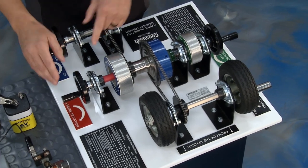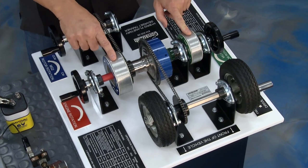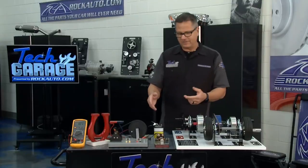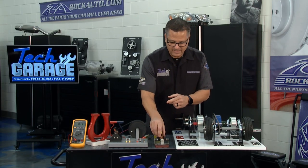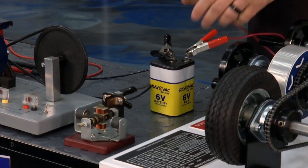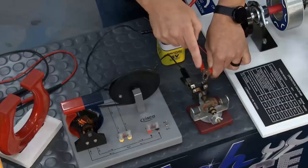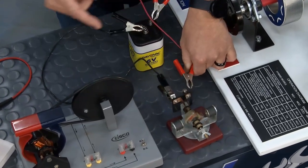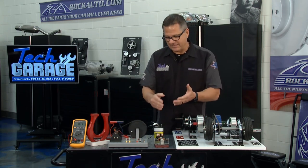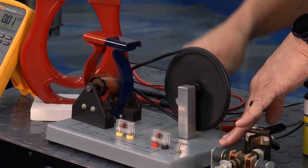It all boils down to how the car works. You have a motor here — we call this an ICE, internal combustion engine — and then you have one or two motor generators. We have to know what's a motor and what's a generator. I have a simple motor with a couple of windings right here. I can hook it up to positive and negative with a 6-volt source and show you the magnetism as it starts to spin. So my electric motor takes off and there it goes. Now, there's a term called counter-electromotive force. You remember those old generators? It actually sends some voltage back up through the system — and that's our generator right here. It actually induces a voltage, and when I spin that, you can see it right there.